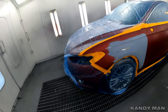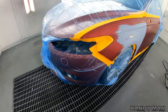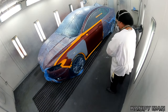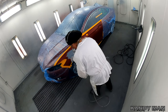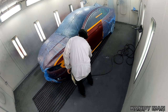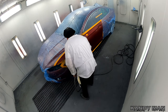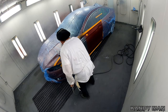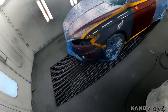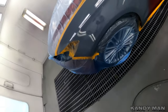We got RR — we're going to shoot this quick one on a Friday, got a big day ahead. We're getting ready to seal this one and I'm using my Iwata — my old clear gun that you guys know, the WS400. Really good gun, it's been around with me for about 10 years and it's still working well. I just retired it from clear and made it a sealer gun because it's beat up and old. It sprays a nice coat of sealer. This was just a two-panel job — three-stage RR — see how nice it lays out the product. The Iwata is a really, really well-developed gun.